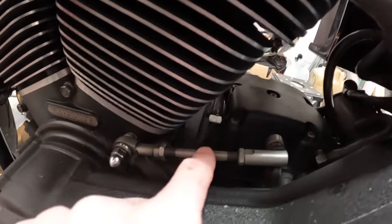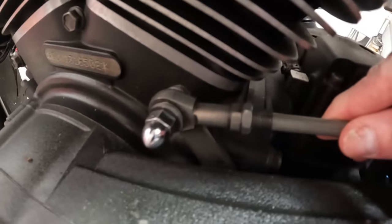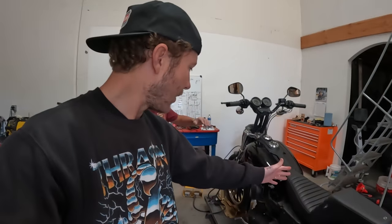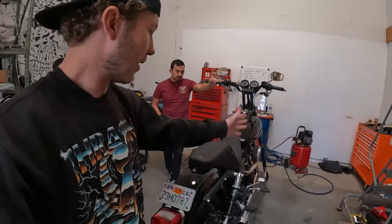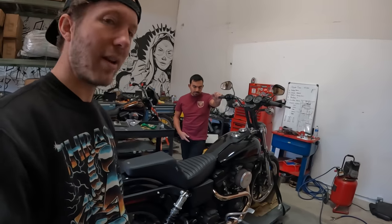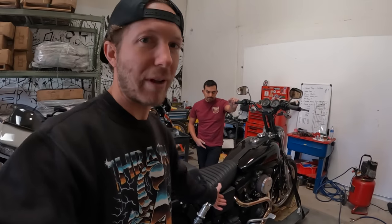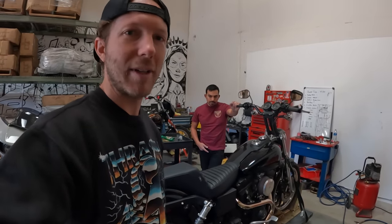These linkages are really hard to adjust - you have to take them off. What we're going to throw on is much easier to adjust. Between the new saddle and seat, the Mikuni carb, and the exhaust which made the bike run night and day better, I think we're riding this thing and enjoying the hell out of it. Maybe fix that leak at the primary and it's ready to roll.